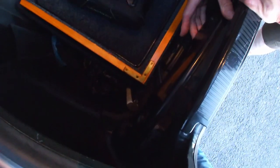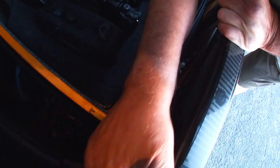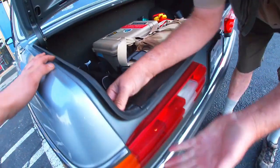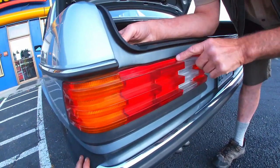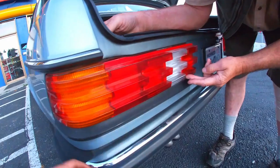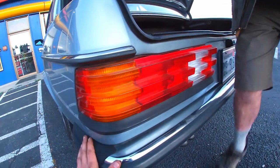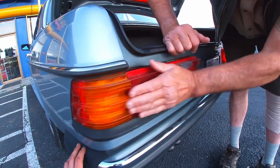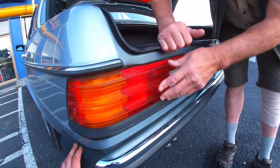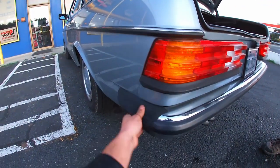See how these pods go in — you have two big nuts here, and right here you have a seal. You want to make sure the seal is seated properly. Here are the bolts that hold the pod to the body — there are two bolts over here. Mine had a crack so when it rained, water would come in and I could see it inside. That'll cause rust in your wing — they call these wings, quarters over here. So both of these are brand new from Mercedes — genuine Mercedes parts.